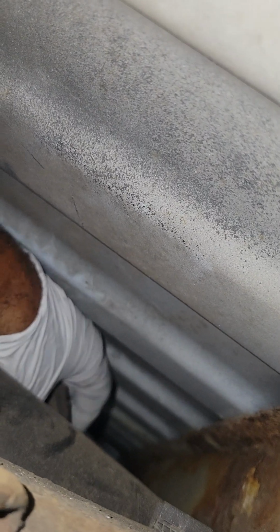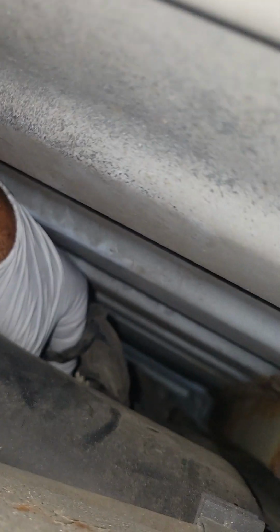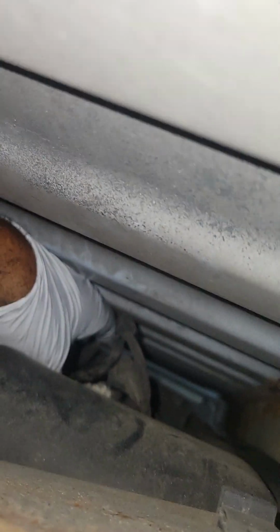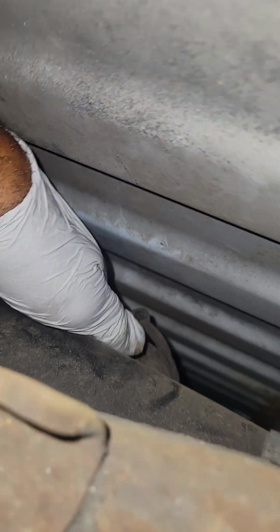See, right here is the fuel tank pressure sensor on this vehicle. Again, you see where I am, filler neck, follow that hose in, and it's right there. You can easily grab it, okay? Here it is, right there, right here, okay? So it's pretty easy for the most part, guys. You just want to make sure that sensor is pushed all the way down and seated.